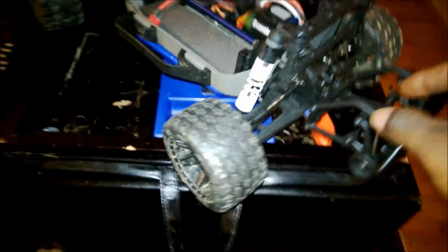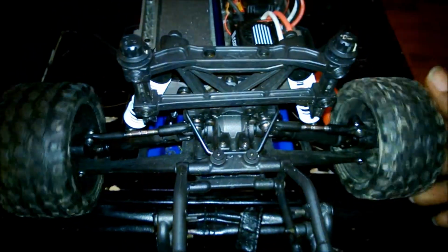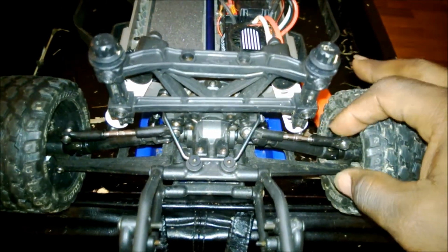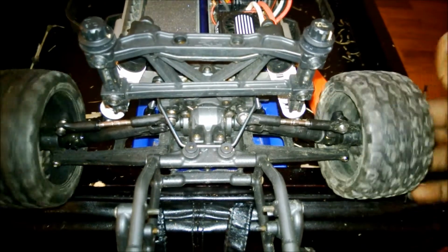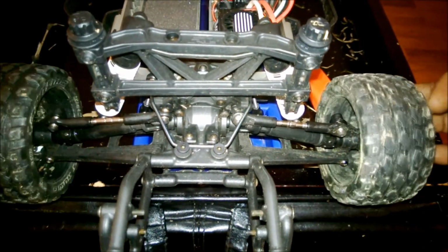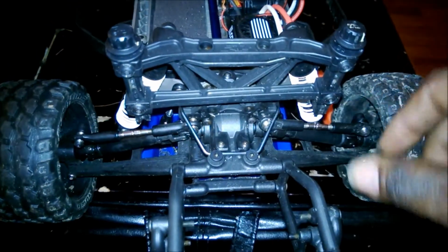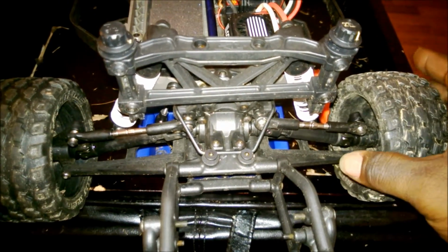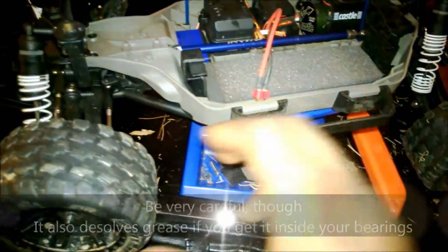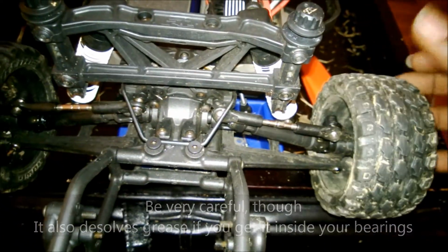So first obvious thing, you have your wheel bearings, and these are fairly well insulated down here, but you need to give them a check. If water got in there, the stock bearings corrode, and they can corrode pretty severely. So check that they roll pretty smoothly. One of the little tricks I did with my cars, I gave it a liberal spray down of key points with WD-40. WD-40 repels water, so it helps to keep the water out of areas that you don't want it. The water still can creep up inside of there, so it's probably worth it to take off the wheels, take out the bearings, and give them a quick status check, just make sure that everything's okay.